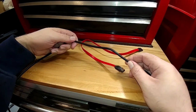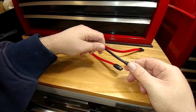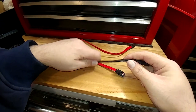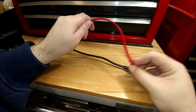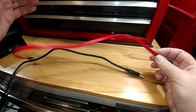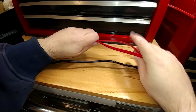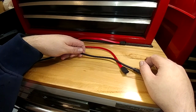But what I would have liked to have done was get a round cable. You'll see these flat ribbon cables going back to the 80s; they've made round versions of them over time. For all intents and purposes, you can get a SATA cable on a round cord. The reason people tend to prefer the round ones is they're much more flexible and much easier to route — if you want to zip tie stuff together, round cables just work better for that. These flat ones, especially the inexpensive ones, are very stiff and want to spring back into whatever shape they've been stored in. Look at your situation and see what works better for you. I'll find some round ones and throw you a link below.